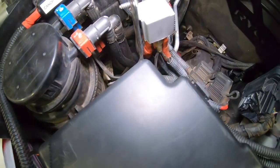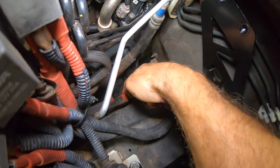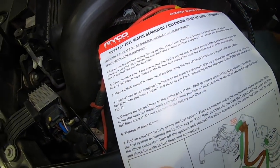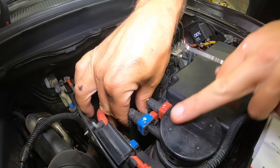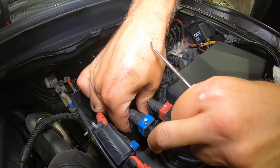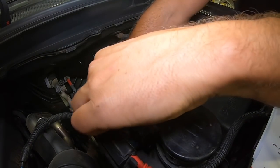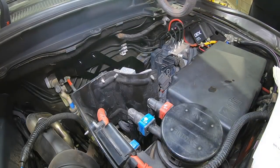So we'll take that off, and then you've also got to trace it back down and pull it off the fuel tank line here, so it's the lower one as well, which I'm finding hard to show you, but it's this one down here. We're going to take that hose off, and then we can fit this filter and run the new hose. There's the clip. Oh, there's one hose. There we go. It's easy to pull it out down from the bottom. And that's it, that one there.